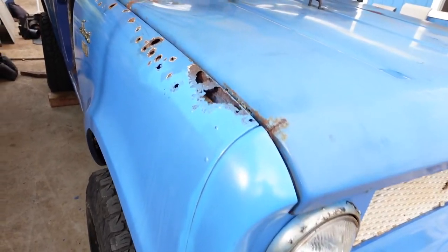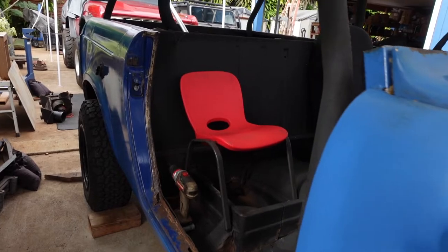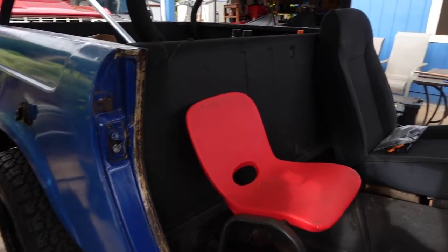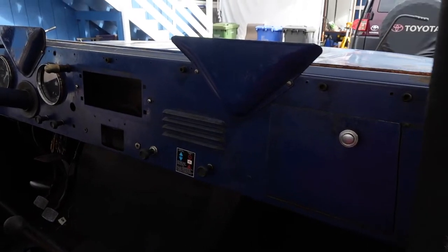For a 1962 with the original body, it's actually not that bad. For someone like me who works on cars, I can look beyond the rust holes, look beyond rust on the body, so long as the main foundation — the frame — is pretty solid. This particular Scout has an original body; it's quite rusty everywhere. There's a big rust hole on the left front quarter panel, rust holes in the back of the bed, and the hood is dented. There's a lot of work.